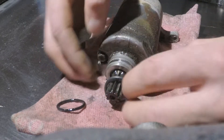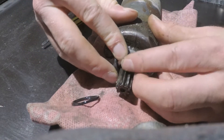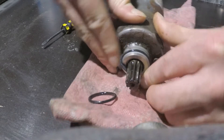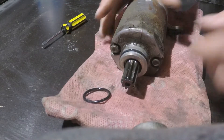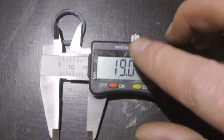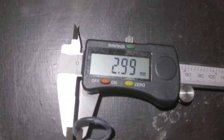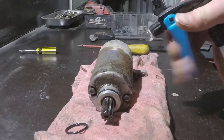You can see here I've got a slightly bigger o-ring this time, slightly thicker. I'm just going to put this one on — it's not the genuine o-ring, it's just from a random pack of o-rings that I had in the shed. 50 cents versus 10 bucks or whatever it is that Yamaha is going to charge you. That fits much nicer in there — 19mm internal diameter or 3 quarters of an inch, and the thickness of that is pretty much 3mm.